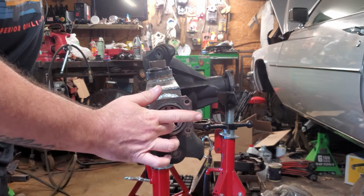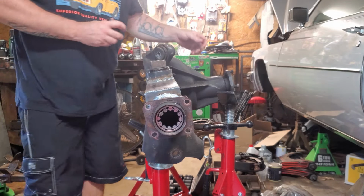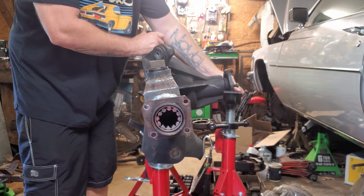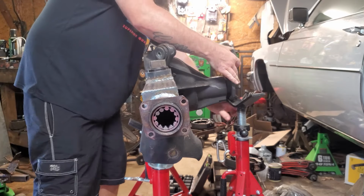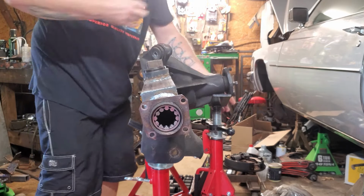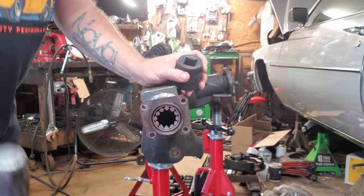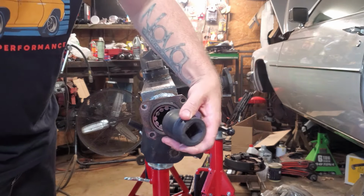Nothing split, which is good. Bearing spin, which is good. Planes flying over. Check our pinion here because it's about to pop off and let the rear end fall. That was the main thing I was trying to kind of keep an eye on because everything's shifting back. I didn't want that shifting off, the rear end toppling off the stands.